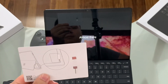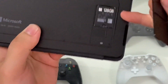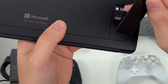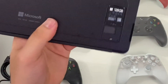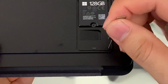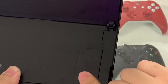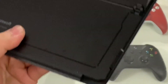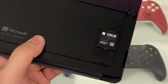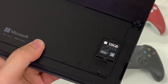Surface pin eject tool — put it in and it just ejects. This gives us access to the SSD: 128 gigabyte custom SSD that you can increase storage. There's no micro SD slot, but this is where you can input your SIM card. Put the pin in and it opens that knob up to push off the metal tray. This pops back in flush. If you're reprovisioning this device and want to destroy the storage, you can take that out, give this device to someone else, and completely destroy this piece instead of having to destroy the entire unit.